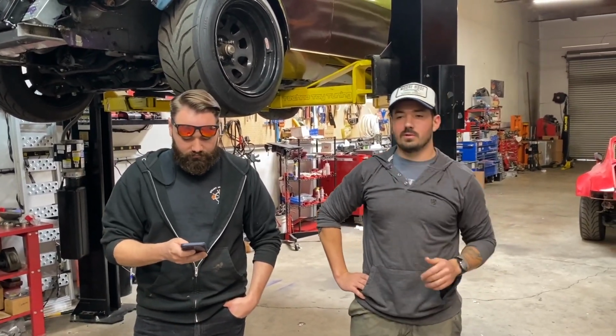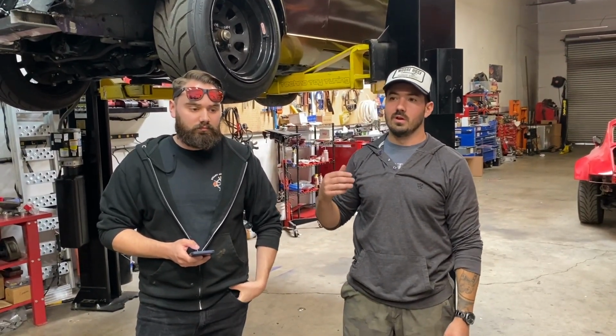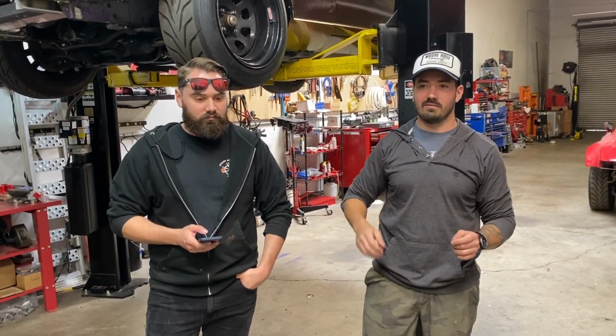That's always cool. The other thing I want to briefly touch upon is tuning. We tried a little bit today, but some of the things that we noticed were the tuning adjustments on the Alder are super fine. You turn it a little bit, and that was enough to pull the low end of the fuel out enough to put it in a no fueling position. It wouldn't even start. So there's a lot of things you can do with that Alder. You can flip the rack. There's the low and the high fuel.